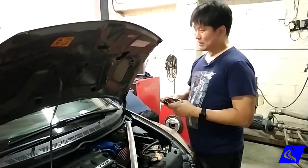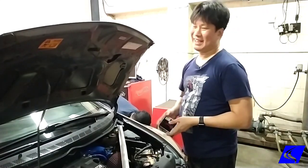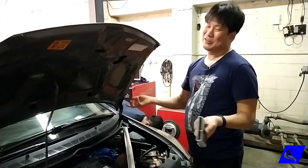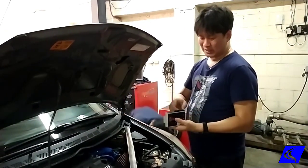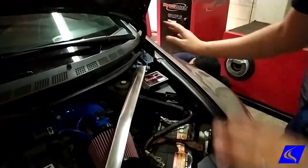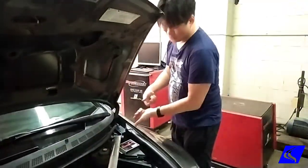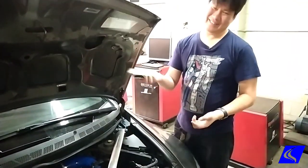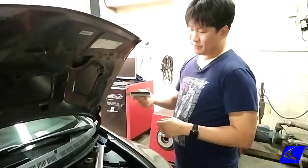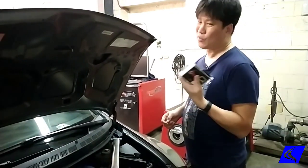The number one thing we see is that water gets inside the terminals. Most of the time our unit chip install is here in the engine bay because it has to be near the ECU. Sometimes a careless car wash worker takes a hose to the engine bay and water gets inside. Also, there are eight wires that connect the unit chip to the computer box, and if they try to remove it without taking off the battery, there's a chance they'll short the unit chip.